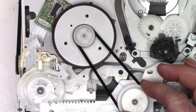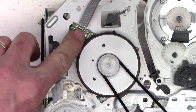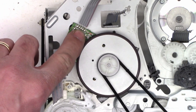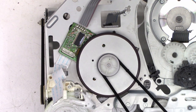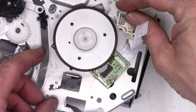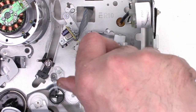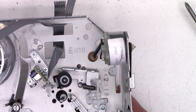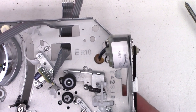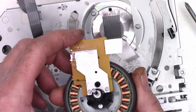The next step is to actually remove the capstan motor from the chassis, and that's done by unsoldering these five pins right here from the ribbon cable, and taking out the screws on the bottom of the chassis so we can get the motor completely out and take a look at it. The brake is free right here — it's definitely bound up. There are two more pins for the loading motor I have to unsolder from the bottom. Now it lifts completely out.